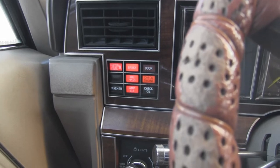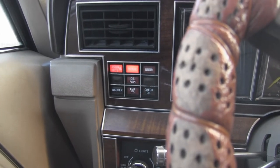The first problem is that this little brake light comes on. Now that can just be as simple as the fact that your brake fluid levels are low, or in our case it could be something slightly more serious. I can't show you right now, but when you brake the car there are some very loud and very ugly noises coming from the wheels — it's grinding, and by the time you hear grinding, that means there's a big problem.